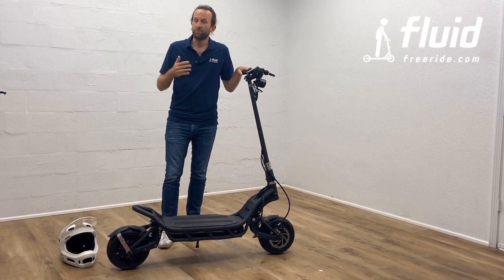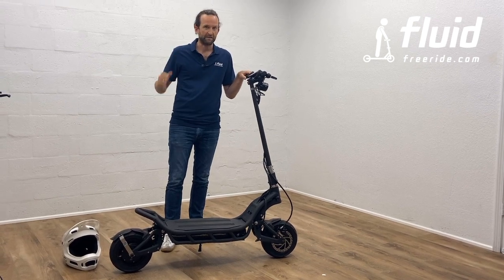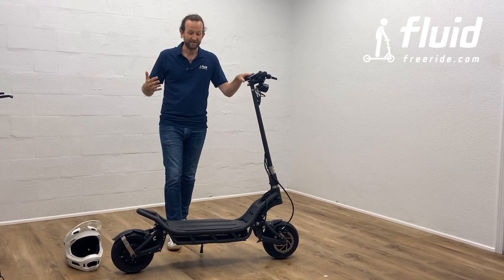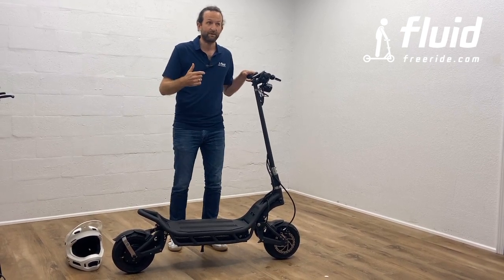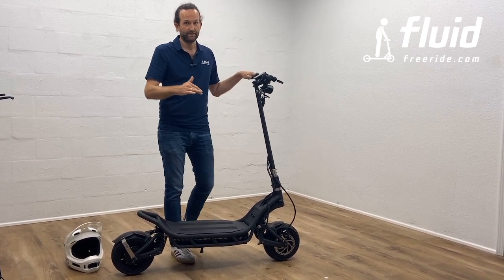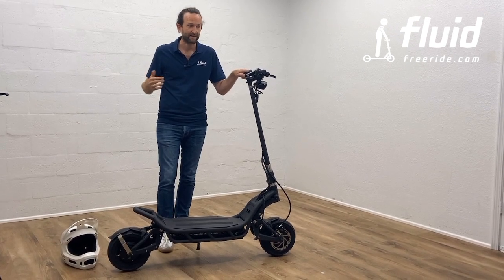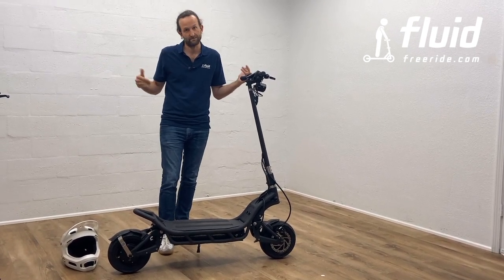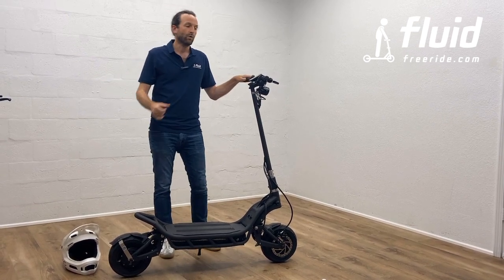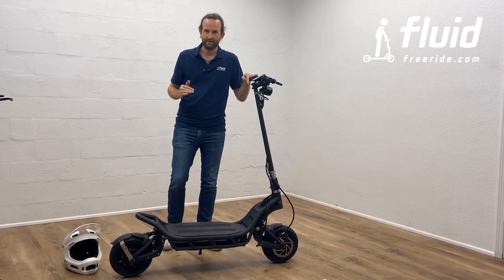There's not really a real warning coming. The only thing that we've heard is if you go extremely fast, let's say 60 miles an hour, and you're a little bit heavier, and then you take your thumb off the throttle, you may experience a little bit of this as you're coming down. Now, the one thing you don't want to do in that time is panic and start pulling the handlebar somewhere, because you don't want to fall at that speed. Usually what helps is a little bit of braking or a little bit of extra gas, because it puts the scooter back stable to where it is.